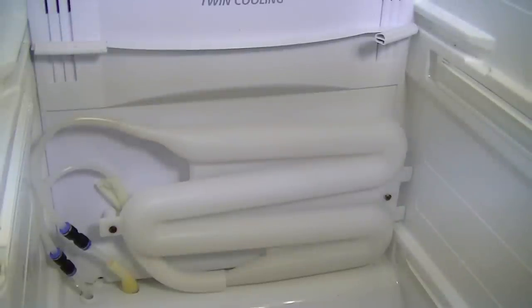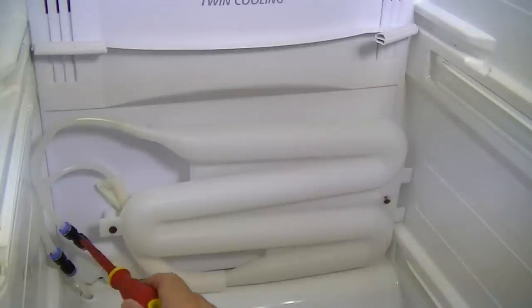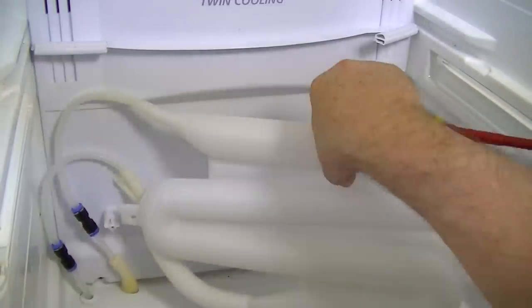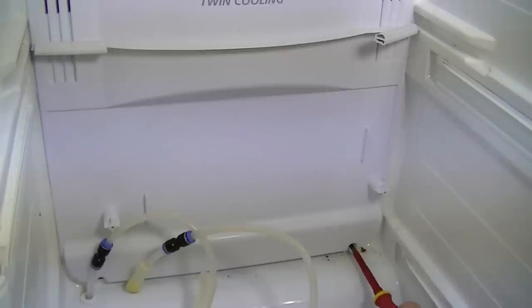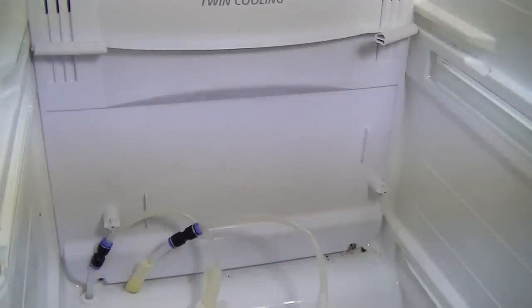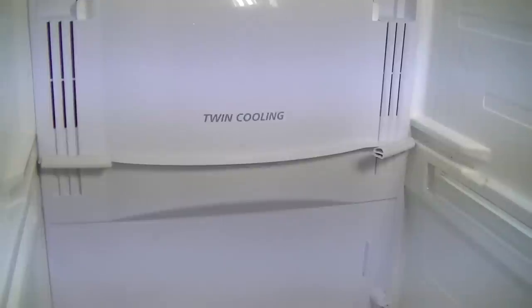Basically you need to take the water bottle off first, which is quite easy. You might notice on this water bottle I've got a couple of fast fit connectors on — I'll show in another video how to change the water bottle using these. Basically unscrew the bottle, lay it down gently, and you'll get access to the two screws right at the bottom — one on the right and one on the left. Now you might find at this stage, if you've got a lot of ice on your control panel, this panel won't come off so easily. What you're best to do is leave it a couple of hours and let the ice melt.